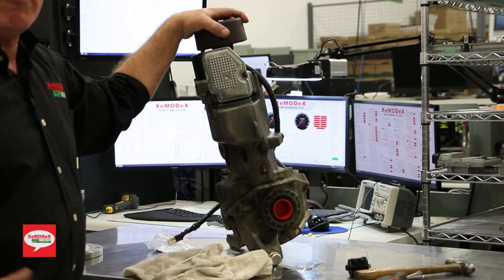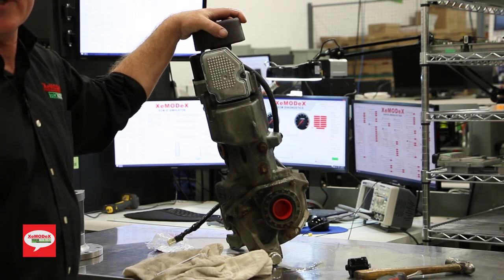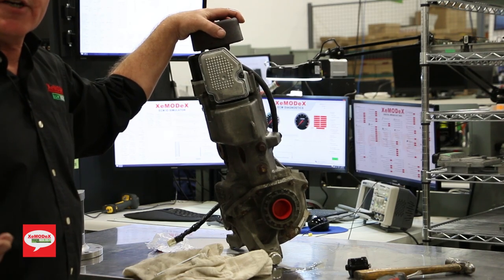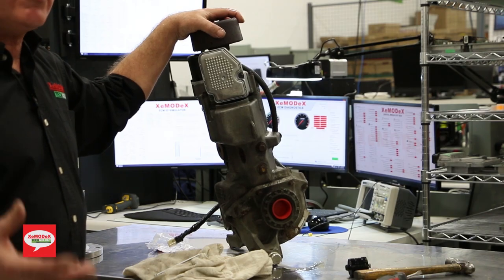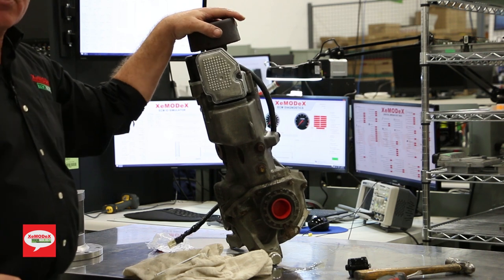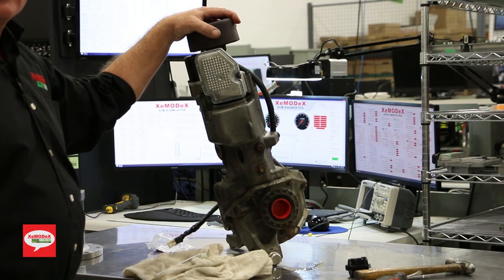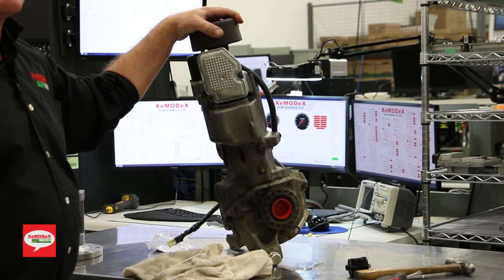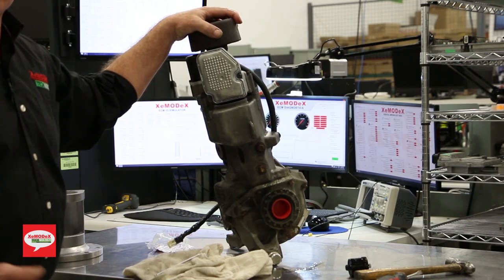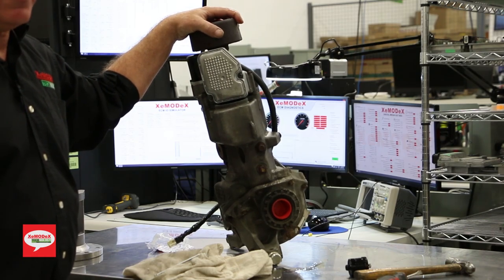It's not a 12-volt reference point that's basically direct voltage there and the pump operates. It's a pulse width modulated signal. It's a frequency with a duty cycle. Now, these things are constantly going on and off, on and off. Sometimes it's a good idea, it's recommended that whenever you send a differential module to us, that you give it straight 12 volts. And if it doesn't sound noisy or it's not seized, chances are it's going to be good, especially when it's only drawing 1.5 amps, just as an example.